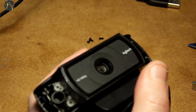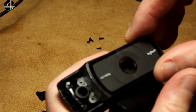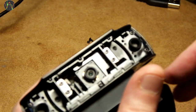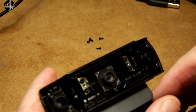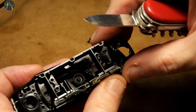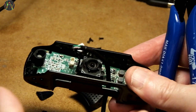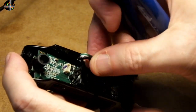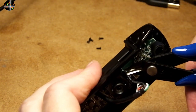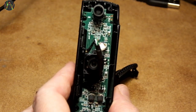I can now remove the lens cover, and expose another four screws hidden inside. With all these out, the final plastic piece comes off and exposes the PCB which, you guessed it, is held by another four screws. With these out as well, the PCB is now just held in by the USB cable. It ends in a connector which I have just unplugged from the PCB, but the shield is actually soldered on. The easiest way to free the PCB is to just cut this last wire with snips.